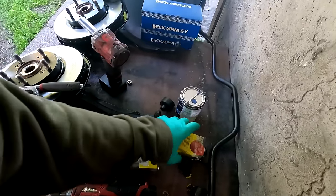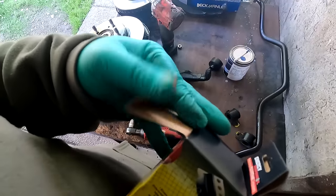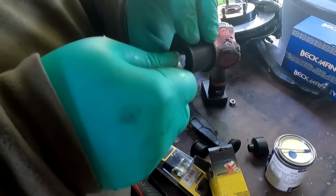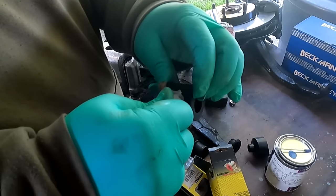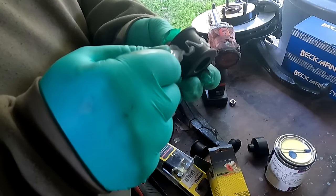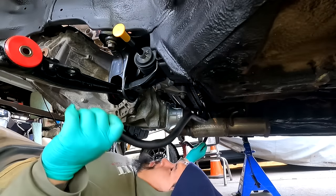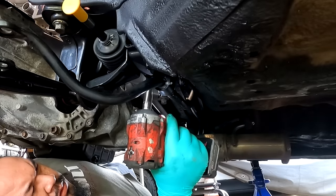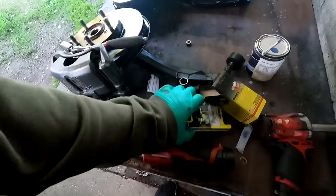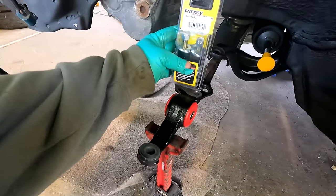Before the traction bar, I'm going to do the sway bar because the sway bar connects to the subframe and to the lower control arm - it's actually going to help keep it up instead of drooping. So sway bar end links and sway bar bushings. I hope I have the right size - 19 millimeter. I didn't measure it, I just went based off the year, make, and model on Google. Going to get the sway bar installed. Next up: sway bar end link bushings - this goes between the sway bar and the lower control arm.